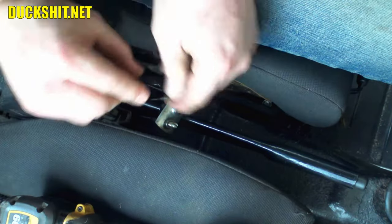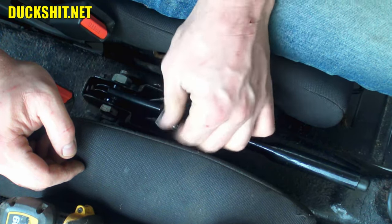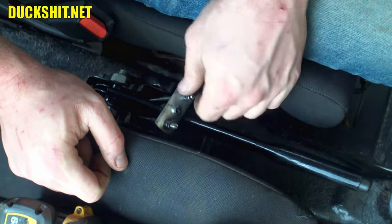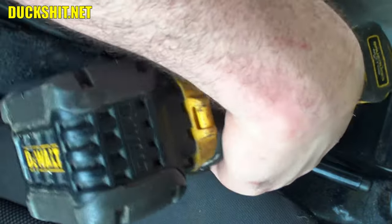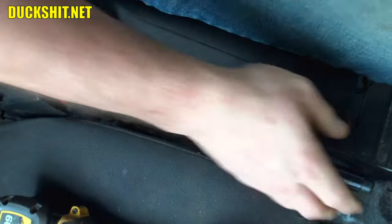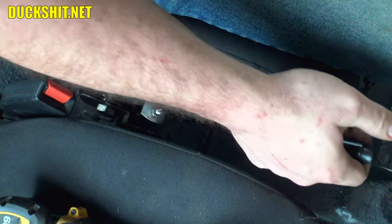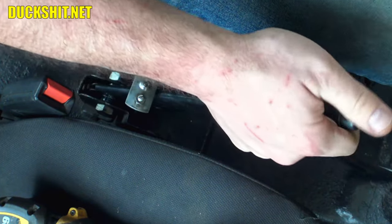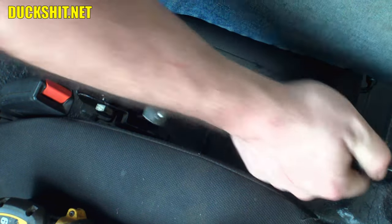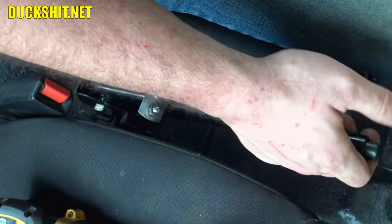Here we go. And I can get the lock nut on top of it. These two nuts, you tighten them against each other so that way they don't back off. All right, wind this one in a little bit. All right, see how it feels. Actually, that feels like an e-brake. Yeah, I can actually feel the shoes starting to get pressure right about there. How many clicks is that? 1, 2, 3, 4, 5. Way too many. Yeah, right around between 5 and 6.